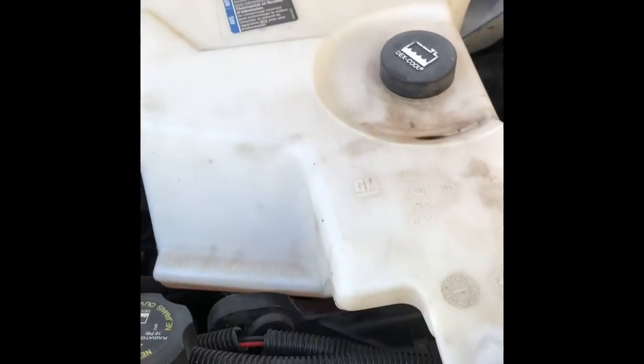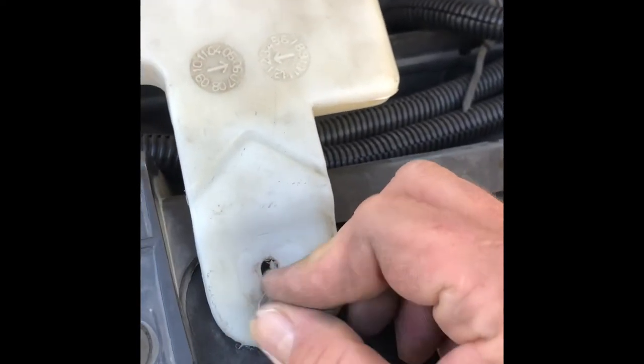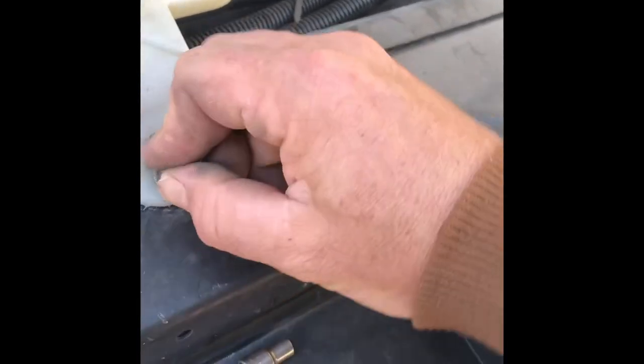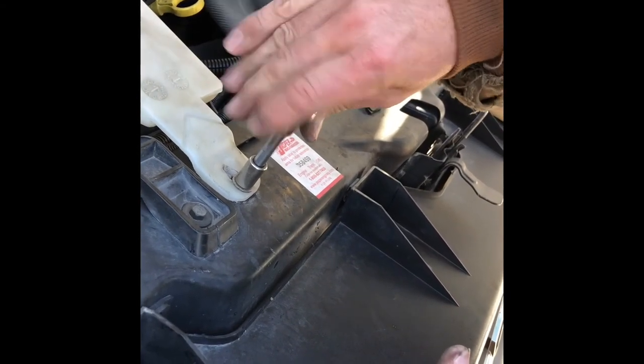Final look here, and then we'll go ahead and reinstall the last piece. Get it lined up in the hole — I elongated my hole a little bit to make it easier. Do not make it tight. Just give it a snug up — you don't want to break the plastic, so just snug it. I can see I need a little bit of antifreeze, so I'll get it to the cold fill level. The blower motor now works, the resistor's good, so we're good. Thanks for following along — we'll see you next time on the farm, and I'll put the links in the description to Amazon if you want to pick these up too.